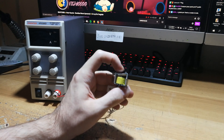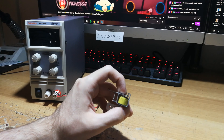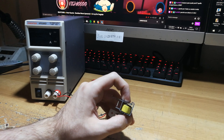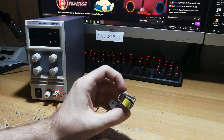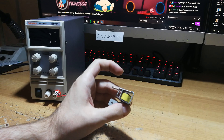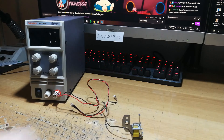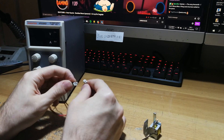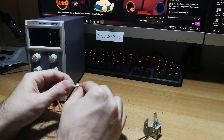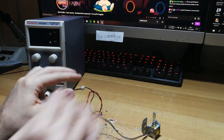But what happens if this stays down? If it stays down, the printer will try to load paper constantly. And if it won't go down at all, the printer will never pick up paper. This is what happens in most of these printers. I'll demonstrate this by connecting it to my bench power supply.